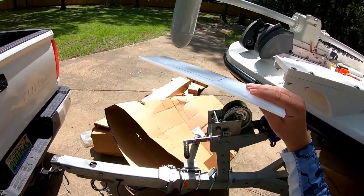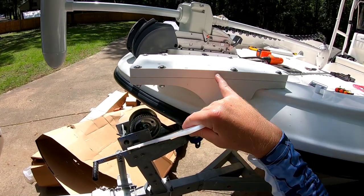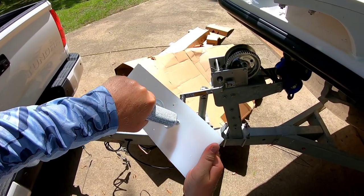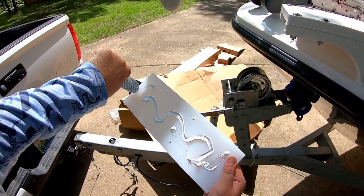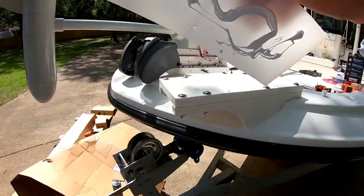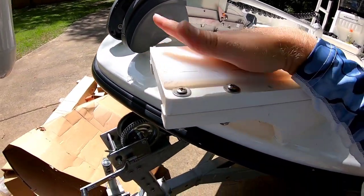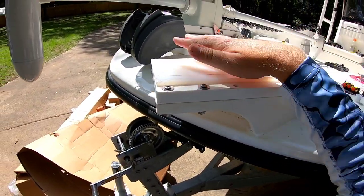Guys, so this is my 1/4-inch starboard. I needed to get that gap filled between the space of these bolts to clear my puck and my mounting bracket, and I'm just going to put some 5200 RTV on here, put it down first. That isn't the greatest job, but that stuff's pretty awesome. You know, like I said, that right there gives me clearance above these bolt heads.